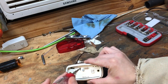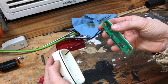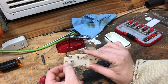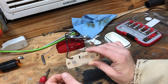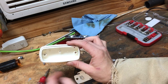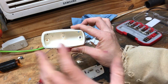I'm gonna remove this center screw to remove the circuit board and set it to the side. My idea is to get another piece of wire and solder it to the brass ring so I'll have a separate ground wire instead of grounding through the bolt. Instead of running bolts through the original holes — which would ground it to the frame — I'm gonna drill two new holes in the cover and get some shallow-head screws that'll fit lower than where the circuit board sits, then mount the circuit board back in and put everything back together.